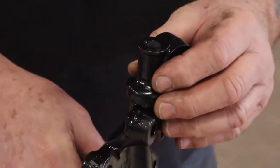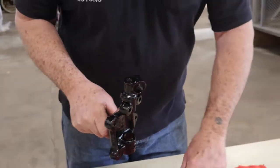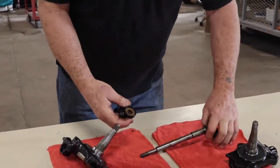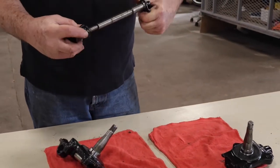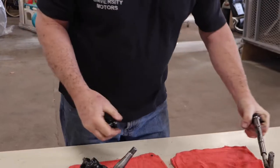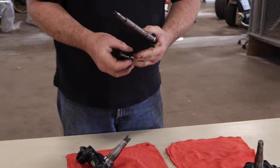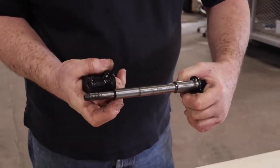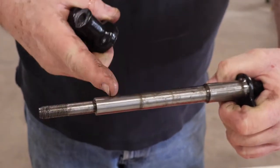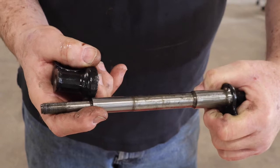And if there's a problem with the overall length of this kingpin, so that the distance when it's assembled and that top nut is tight, oh, watch this, I won't be able to get the top on here, but imagine that I could. Haven't cleaned that out yet, still got paint in it. This sits in here. Then the distance from here to here is that which the kingpin has to ride and to swivel.